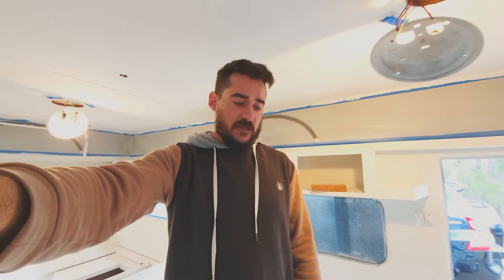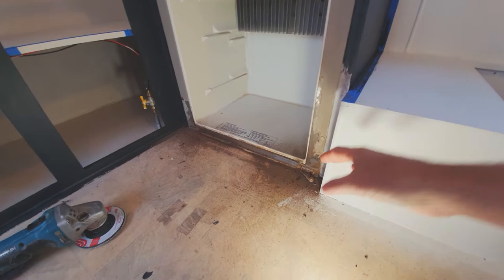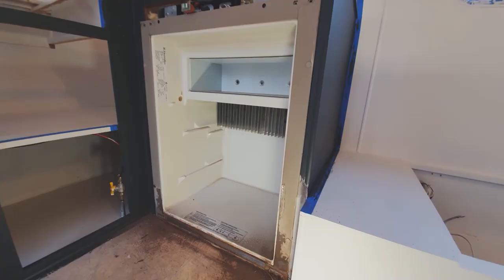I've got this kill rust product that you put onto any rust left over — it neutralizes it to a neutral carbon compound that you can paint over, so it won't rust further under the paint. I think someone's previously painted over it — from about there down it was a grey undercoat, not the original creamy colour. Hopefully this fridge works, because there's a bit of time invested in it so far. I actually haven't tested it yet — fingers crossed on that one.